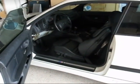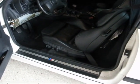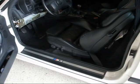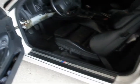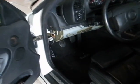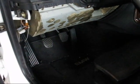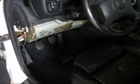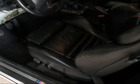The first thing I'm going to do is pull the driver's seat to give me better access to the area underneath the steering. I've already got the panel out — three screws to get that panel that's right where your knees hit, and I think it's probably going to be four bolts to take the seat out and a couple of electrical connections.